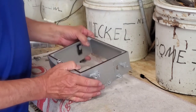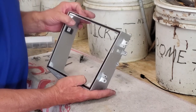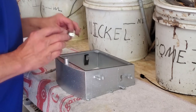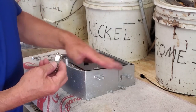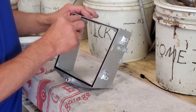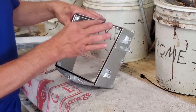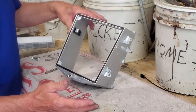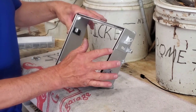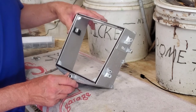We're doing this because we know a number of people are restoring these cars right now, and we're doing this one for Kenny. First thing you want to do once you've got your housing done is create a gasket in this area. In this case, this is a poured urethane gasket that we used. Originally it was cork — you could cut cork, but it's quite thick and fairly hard to cut and get it straight. The poured urethane is actually better since it's not going to show. A good way to seal up the headlight.